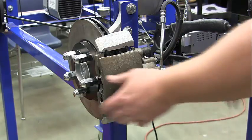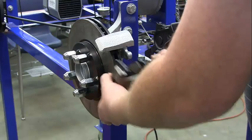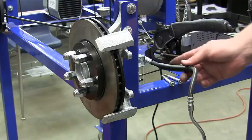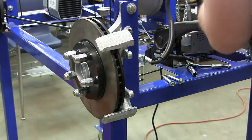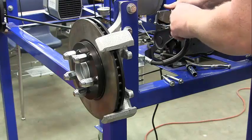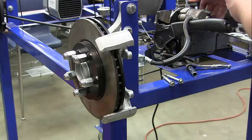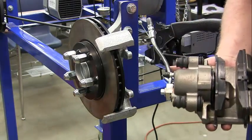This is a one-piece bracket and knuckle, but on your assembly you're going to have to unbolt the bracket as well. Note that. Now this part just pulls straight out from the top. We don't want to let this hang because we don't want to damage the hose, so we want to make sure that we hang this up — I'm just going to place it over here so it's resting safely.